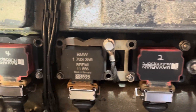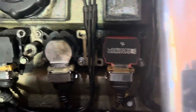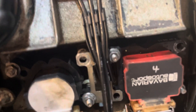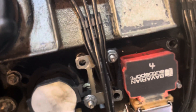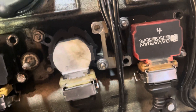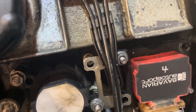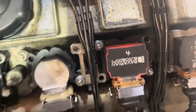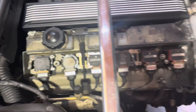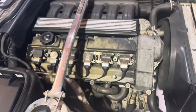What's happening is the spark is escaping the coil — right there, you see it? You can see it even better at nighttime. That right there is the problem. The spark is jumping from the coil and going into the valve cover. We've got a dead cylinder because of it.